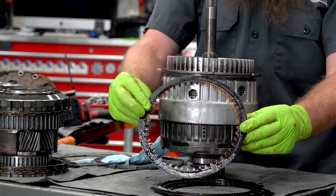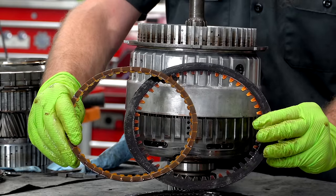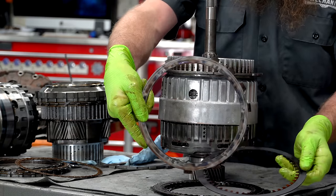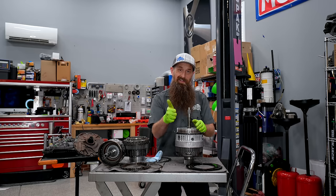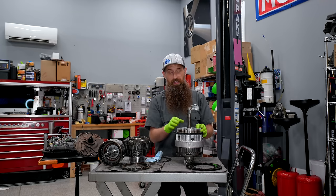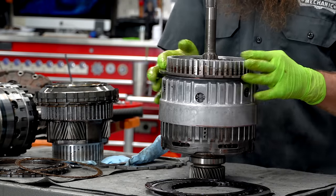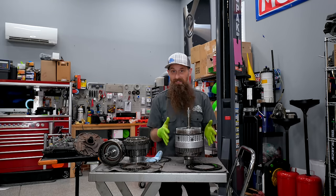Because our steel discs are annihilated and hot-spotted, our friction discs look absolutely horrible. This friction disc is out of our B1 — this is our first brake. This is what a nicer, more fresh one looks like: nice amber-ish gold color. And this one is black and burnt and yucked, corresponding to these hot spots on the steel discs. What likely happened is some sort of fluid starvation to this first brake. This brake holds this drum in second, third, fourth, fifth, and sixth gear, which is why this thing had such bad shifts through multiple gears. When this drum was supposed to be locked and held in place — essentially fixed to the case — it wasn't. Should have been just the input shaft turning, but we had this outer barrel turning at some rate. That's why this transmission shifted so poorly.